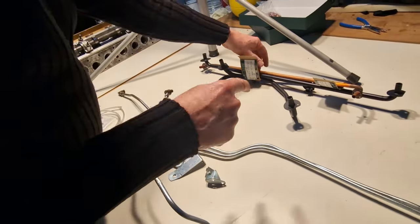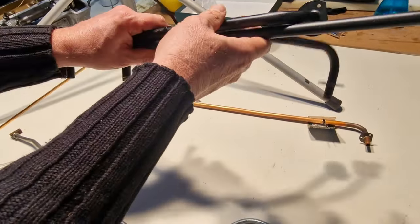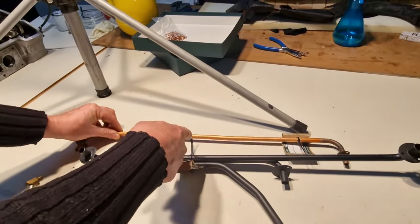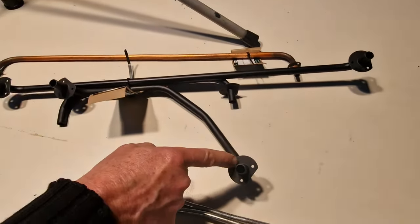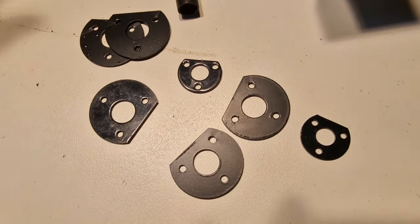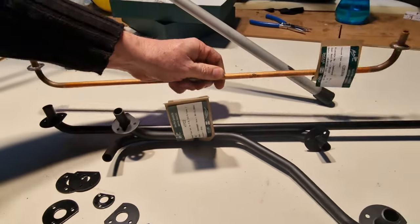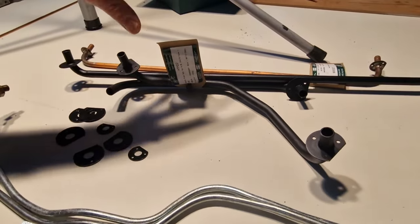The second item: make sure you have the engine cooling hoses ready. This is the set you need to install as one of the first items. For the 4.2 you have four of these, and they are not always available. So make sure you have them ready. You also need all these bits readily available when the body comes back. I could get some, but others were not available at the time I needed them — so this time I ordered them in time. That is crucial to have to start with.